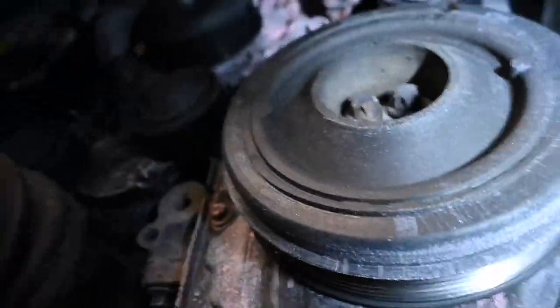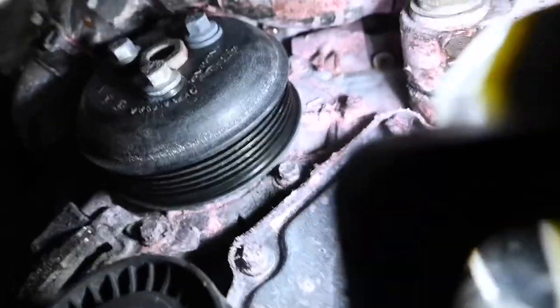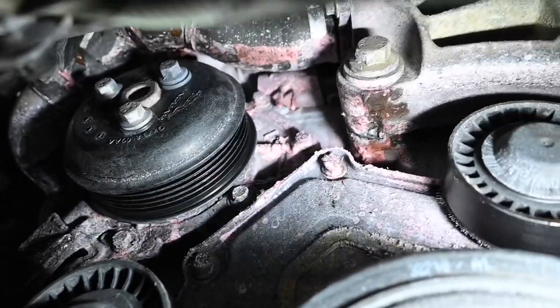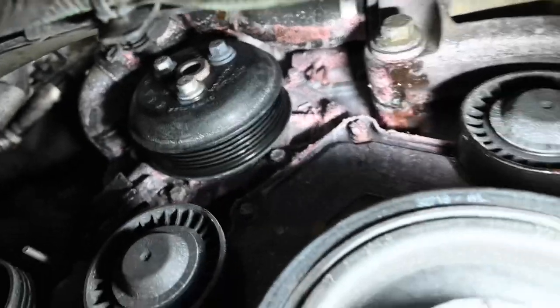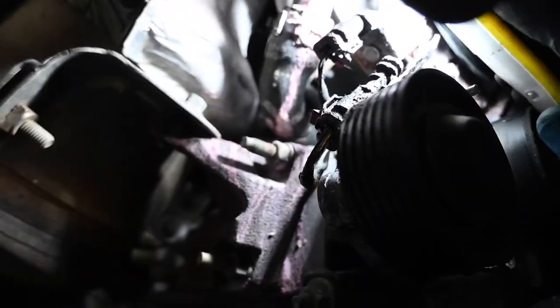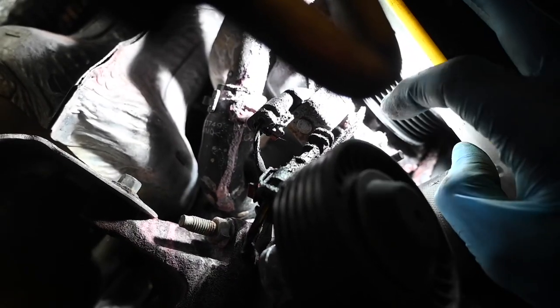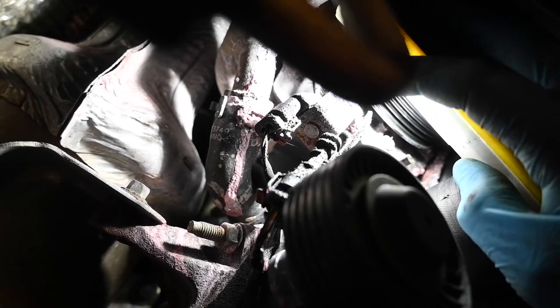I'll probably recommend he has a new belt, but for the time being this will be fine. Now with the belt off, we have a little bit more room and you can really see the extent of the leaking water pump up there — that pulley was spinning so fast and as the coolant leaked out it was just throwing it everywhere. I've also noticed looking at the new pump that this water pump actually has some electronics attached to it — there are two plugs, which come with the new water pump.